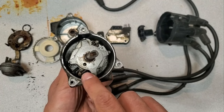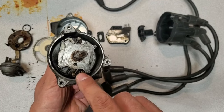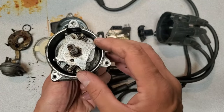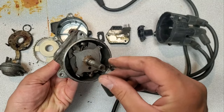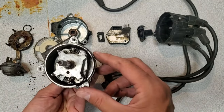So you'll be curious to see what spring rate this actually has and how fast this thing needs to be turning before it actually hits full advance. Those are my observations. I'm going to go ahead and give this a bit of a clean, then strip it down all the way and get it on my distributor machine and see what's going on.